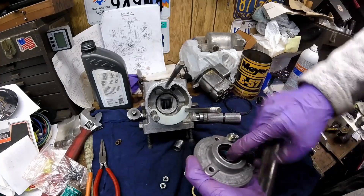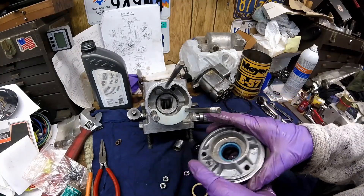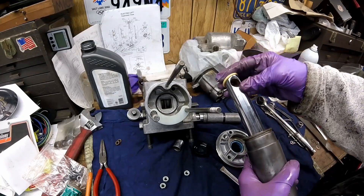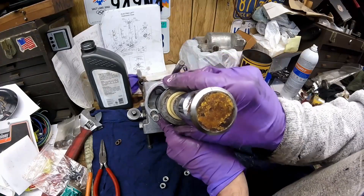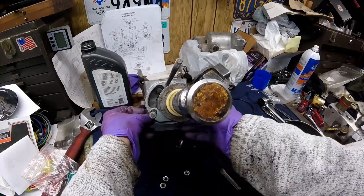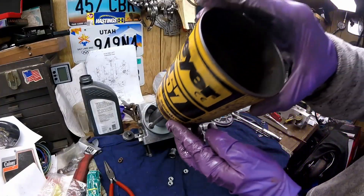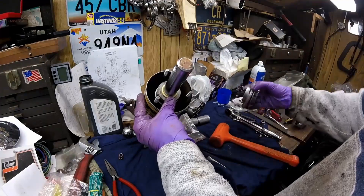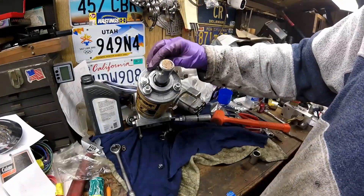Next I'm going to coat the lip seal with some oil and the guide — get everything nice and lubed up. Then you want to install the washer; the grooves go towards the cylinder. Then you install this dampener washer. Now you install the cylinder. Before you install the outer cylinder, you've got to put the O-rings on the body, and also install an O-ring on the cover. You slip on the outer housing that holds the oil. After you install that, now you install the top lid — and you want to make sure that the fill is out front. Now you torque them all down.